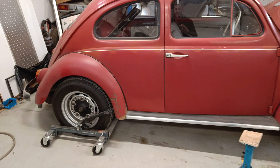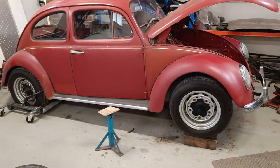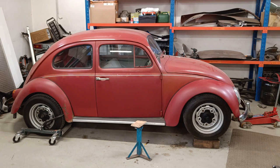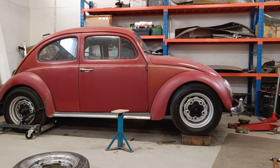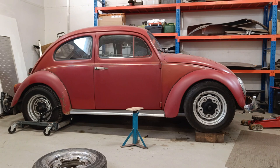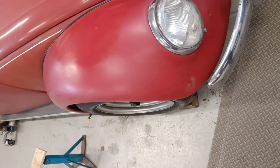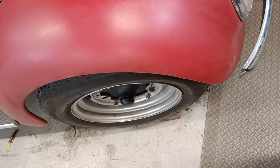I put the back wheels back on the ground, put the handbrake on and put it in gear — I need to get underneath the car and it's on wooden blocks, so it's really important it doesn't roll off and squash me. Never get under the car if it's not safe. I jacked the front up, loosened off the adjusters, brought the jack down to about where I wanted the ride height, tightened the locking nuts up, and jumped up and down on it to make it settle. Under the arches it looks so much better — it's amazing what that extra inch can do.